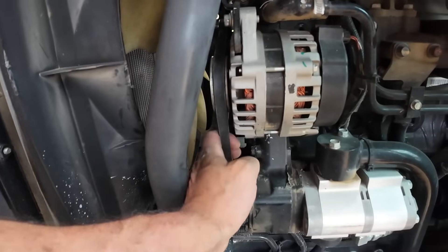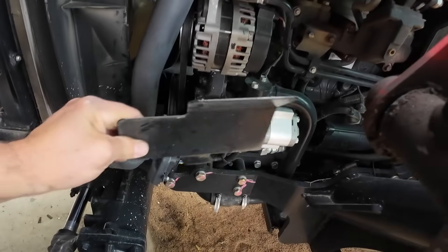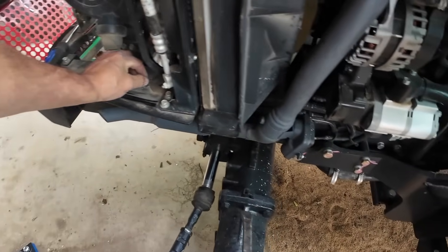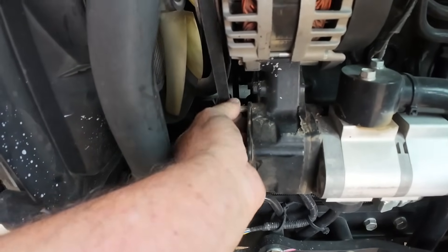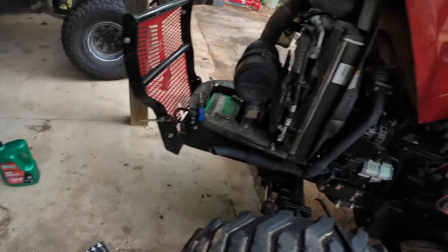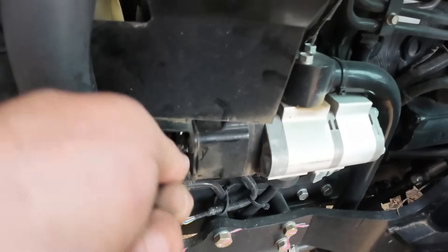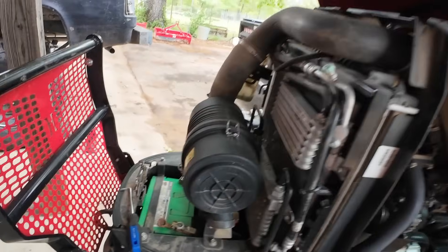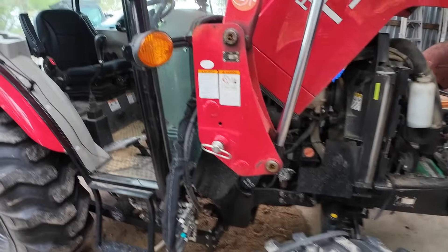These are 12 millimeters. Here's the correct tension. I actually did take this off and I'll put it back on now - it was 12 millimeters as well. You can start the bolts here and then it's got slide-on grooves that you can tighten them up later. So now let's put this back on, get it tightened down - snug as a bug in a rug - and we will be good to go with this belt. Now that she's put back together, let's see if that indeed stopped the squealing. Let's throttle it up. Alright, that was our problem - that belt is good to go.